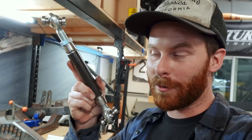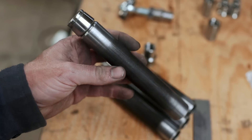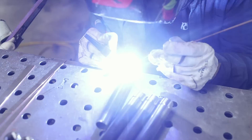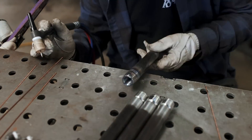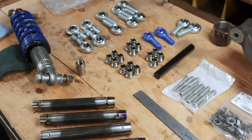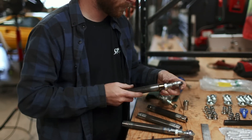Last but not least, if we want the car to support its own weight, there has to be some form of suspension like a coilover. I don't have our coilovers from H&R yet, so we're going to make our own — some temporary turnbuckles that we can bolt into place to hold the car up until we get our coilovers from Germany. To make these turnbuckles, I'm using the same DOM tubing used for our control arms, paired with threaded tube inserts and rod ends. All four corners will use a coilover of the same overall length. Each turnbuckle gets a 5/8 inch rod end at each end — one right-hand and one left-hand thread for adjustability — and misalignment spacers to drop the imperial rod ends down to metric hardware so all bolts on the car remain metric.